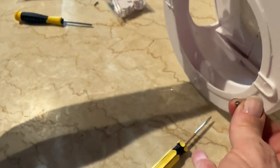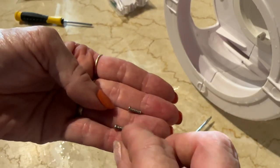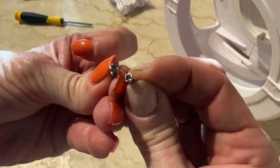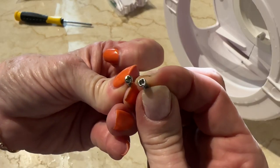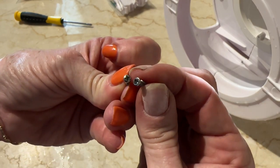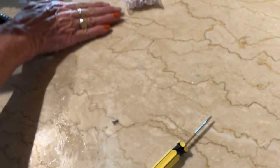Let me just have a look. So what we've got is two of the same kind of screw, but if you look at the head you'll see that one has been hollowed out more than the other. So this machine has been repaired before and somebody tried to sell it as new — they've burred up that screw, which is why we couldn't get any traction. But with a bit of old grandmother's technology, by pouring boiling water over it, it expanded the same way you get a stuck lid off a jam jar. Six screws — do not lose your screws, put them safely to one side.